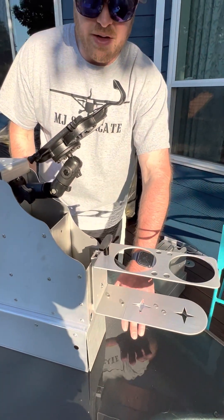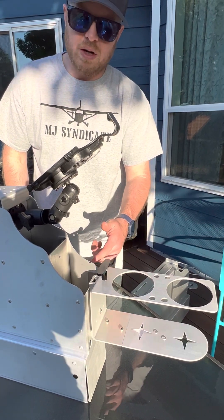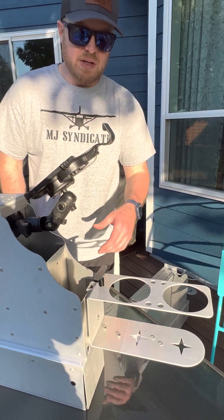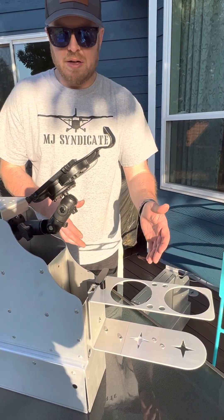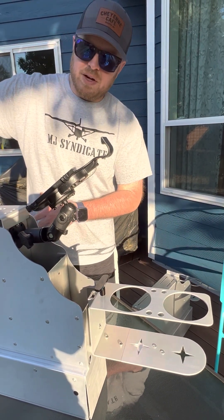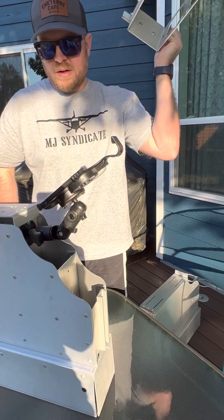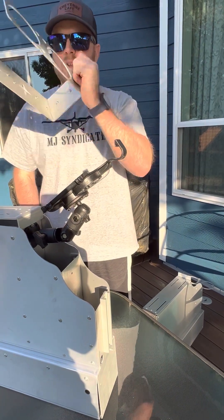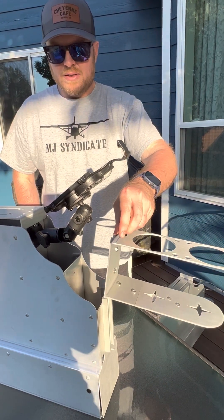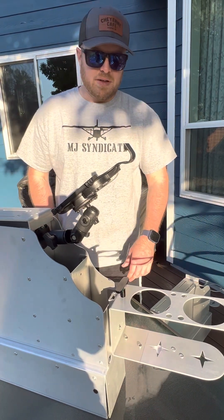You would have your emergency gear handle here, and it still has the hole pattern if you wanted to bolt it on. What I did is put this on a rail and put this aluminum T-handle right here, so if you needed to get at your gear handle you could slide the whole console back out of the way — it'll slide back to the rear seats just fine — or you can pull up the cup holder, give it to your co-pilot or throw it in the back, and slide it back into place. It's keyed, so there you go.